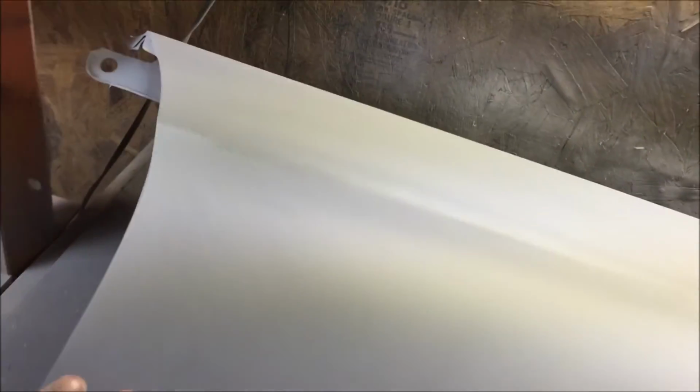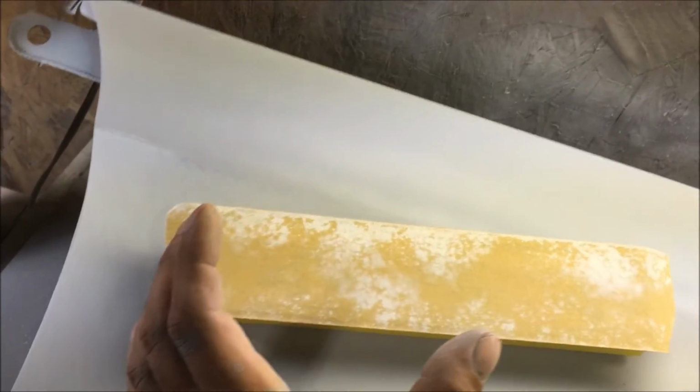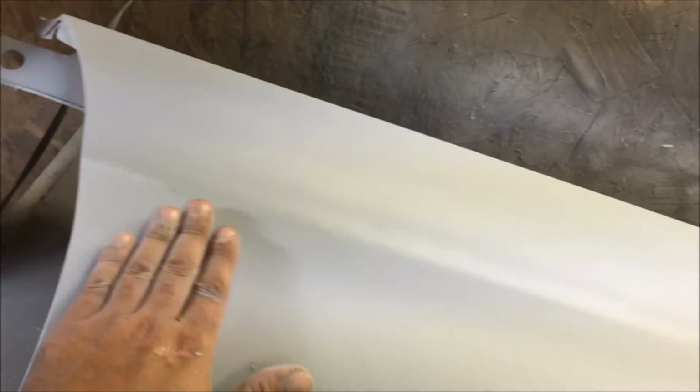We're going to go ahead and put 3 more coats of primer, and then we're going to hit it with 400. Okay, so 400, that's why you want to make sure everything's blocked out with this one, because 400 we're going to have to block it out with a small block. But if we know everything's done with this big block, then we don't have to worry about it.